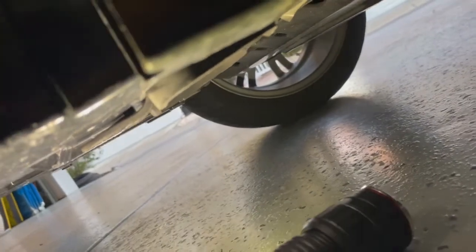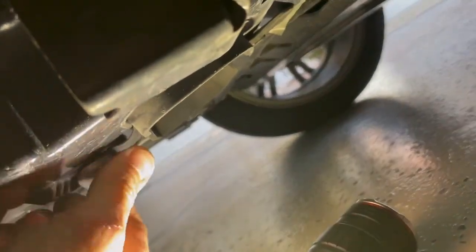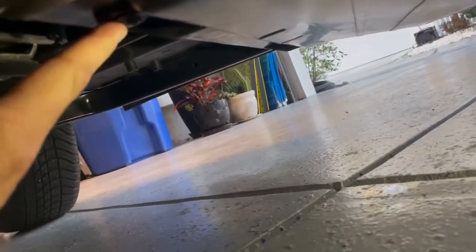The first thing you want to do is get underneath your golf cart. Right up here is the muffler outlet — this duct kind of goes onto the muffler. So first thing you need to do is take that off; just pull this rubber back like that. Then grab your five millimeter socket — it's held on with four bolts: one, two, and then there's two on the other side in exactly the same spots. We'll break these loose and they'll come right out. I'll tune back in after I've got all these out and show you the next step.